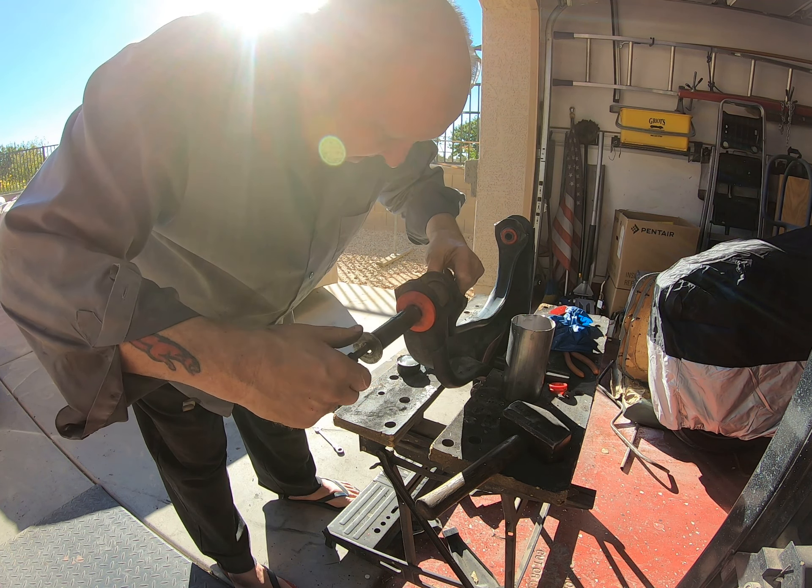This is the upper control arm. In order to get the upper control arm ball joint out, I ground it off and then hit it with a hammer. As you can see I'm burning this bush out - I'll just leave it to do its thing. Here is the ball joint itself - I cut this off, then hit it with a hammer, and out she popped.